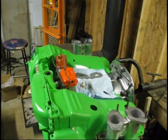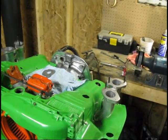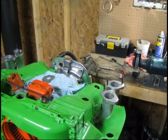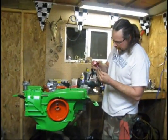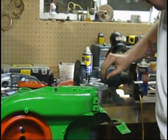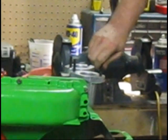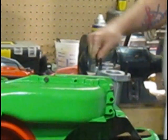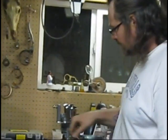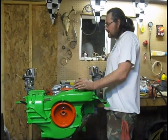We have another shop visitor — it's my wife. She came out to see the new carbs, which aren't on yet. She's been waiting for this, and while she's out here I'm going to see if she'll assist and get a little video for me. I'm going ahead and putting my last stud on here. I've been putting Loctite on the carburetor studs and screwing them down. These things fit so closely in these carbs, I just put a little bit on there to hold the stud. If I take this carb back off, I don't want the stud following it out. Let's go ahead and put a gasket on here, grab one of my carburetors — it goes on this side. I've got to put the nuts on and get the carburetors all tightened down good.